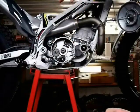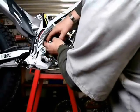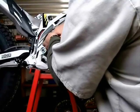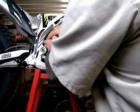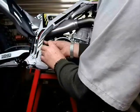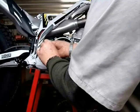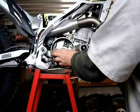Now the cover just goes on, and at the same time I was manipulating the water pump impeller so those two gears would line up. I go ahead and put in the back clutch cover bolt — it's the shortest one in the group. I don't tighten it at all; I just run it in, not even snug, just to keep the parts from walking apart while I continue with my work.